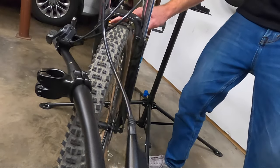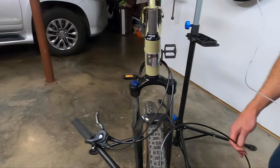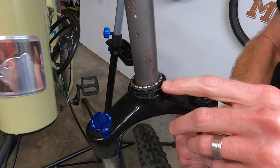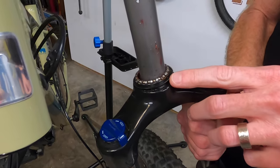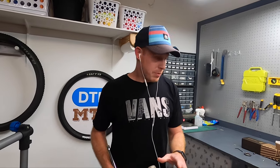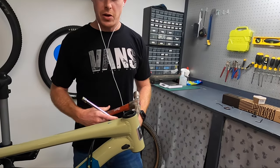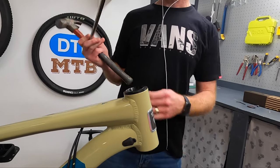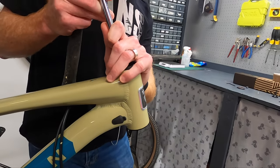Since I'm using the wheel from a different bike I'm leaving it as one piece. Now this is the lower part of the headset and these are the headset bearings. In my first video I assumed since this is an FSA headset they'd be sealed bearings, but they're not — not a huge deal, you may just need to grease them more often. Since I'm putting a tapered fork on here, I have to pop out this lower cup to replace the bottom headset. It wouldn't be a video without improvising without the proper tool — there is a tool to pop these out but I don't have it, so I'll try with a socket, extension, and gentle coaxing with a hammer.